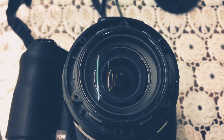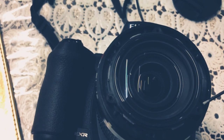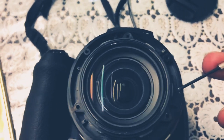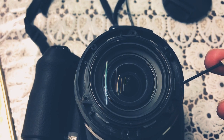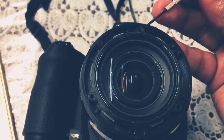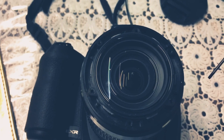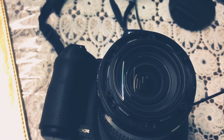Okay, now we can take off the lens body, and I would say gently, just very gently, just lift all these so the glue breaks here, the glue here. Probably just hold the lens with one hand and then just lift it equally, sort of there, all around. Again, being very careful not to touch the lens. And then once you take it off, there should be springs under here, here, and here.